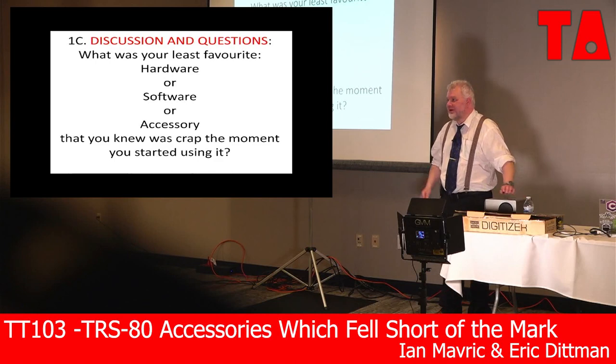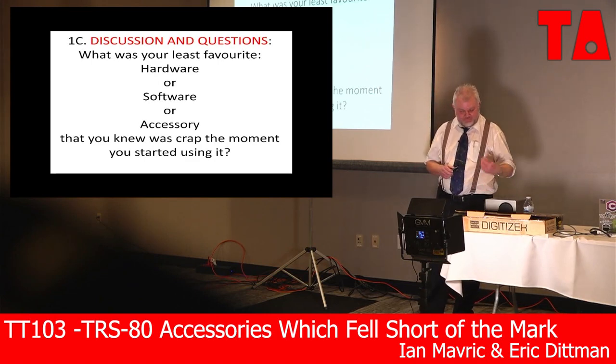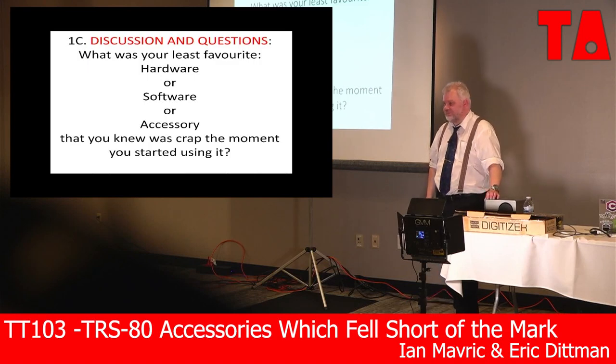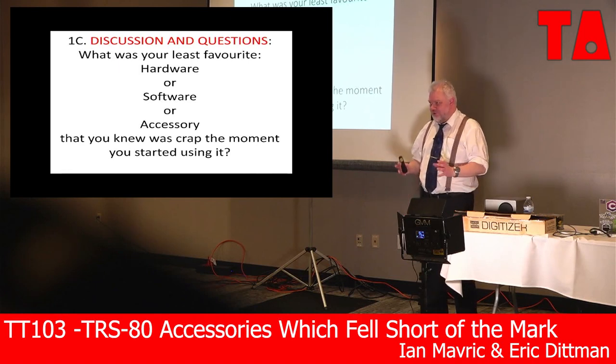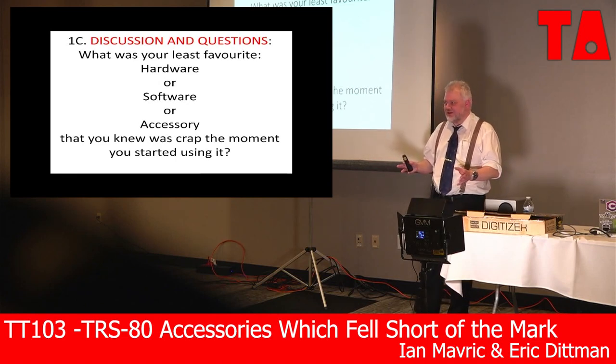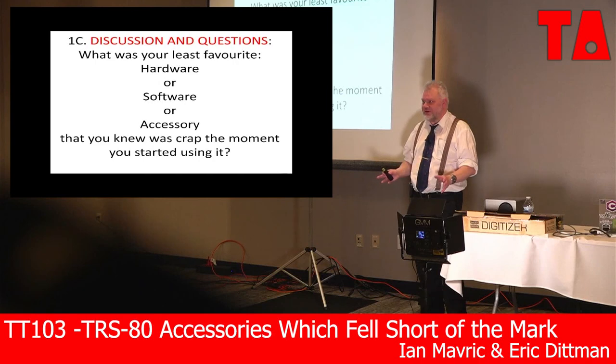Yep. I've got a couple, but the Tandy 2000 didn't make the list. We talked about that. My position is that when it came out, the Tandy 2000 was a great product. But rapidly, 100% IBM compatibility took over, and it went from a great product to a bad product. The performance of the Tandy 2000 was higher than even a lot of IBM's products for a few machines. They called it their advanced series, a high performance MS-DOS machine. That was their advertising slogan. I bought one and it did that. If you had the right software for it, it wiped the floor with every other PC.